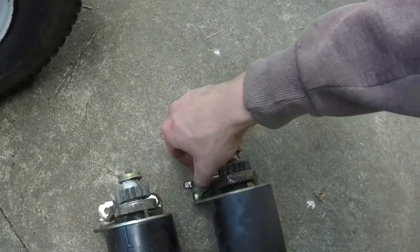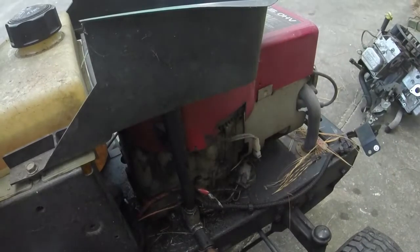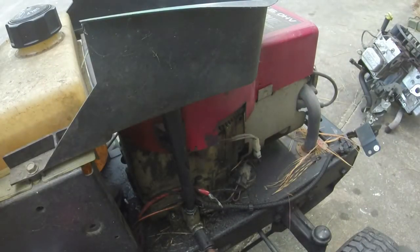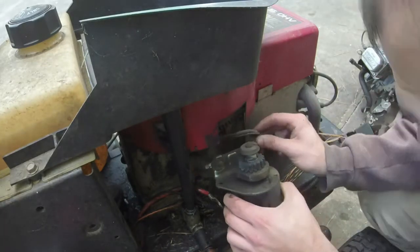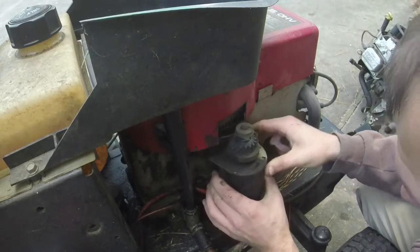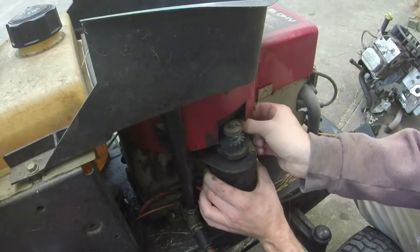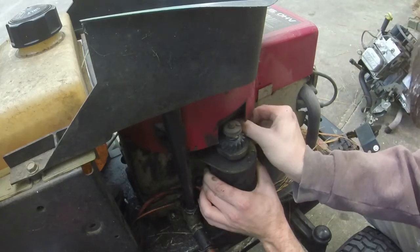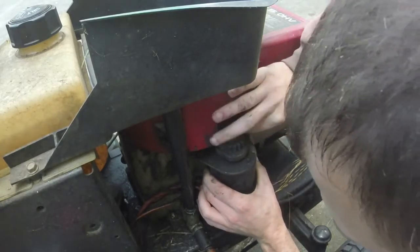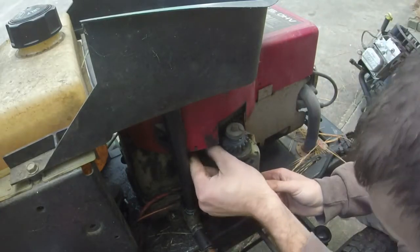I always have a spare starter, so let me get this one on. The same process applies in reverse. The only difference you may notice is there's a little clip here that holds in the stator wire, so we'll keep that clip to make everything nice and tidy. Let me put this back in — should be fairly easy. Again, the hardest part is just accessing that right-side bolt. I'll take that wire and show you after I get this thing screwed in.